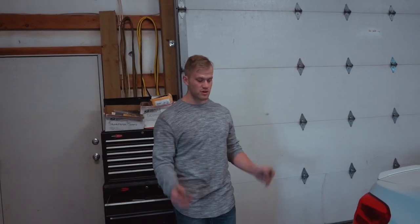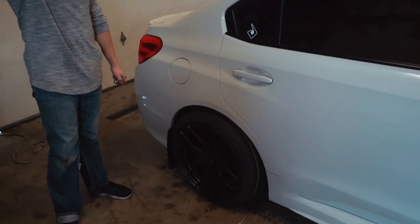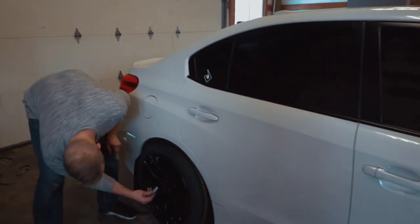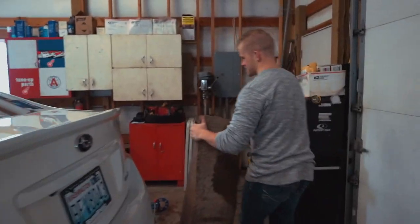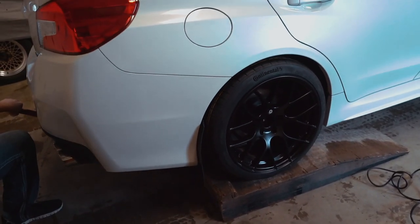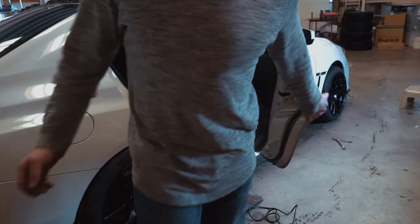It pokes out a little bit but the wheels look really freaking good. What I'm going to do is test whether, when Cameron hits a super big bump, if this wheel is going to hit the quarter panel. If it doesn't hit, I don't really care that it pokes out a bit. I think the more the rear suspension compresses, the more camber goes on the wheel. To test that — this is what fitment gods do — jack her up, grab something like a ramp, put it under the wheel, and lower it down slowly.